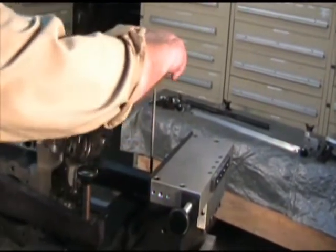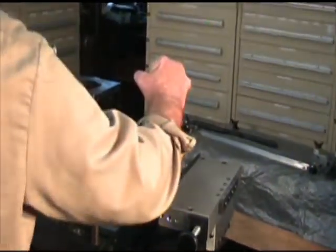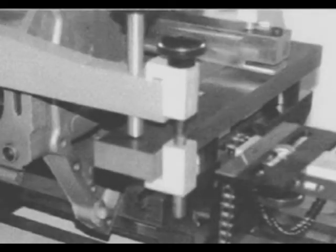Do not spread rollover bar more than one hundred thousandths on each end. Install block rollover bar hold downs on each end of bar and snug down. Recheck level of block and adjust as needed. Block is now ready to surface.